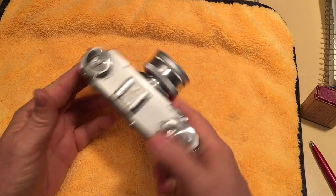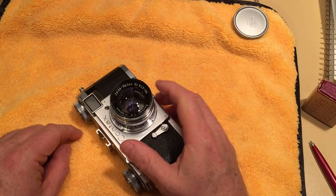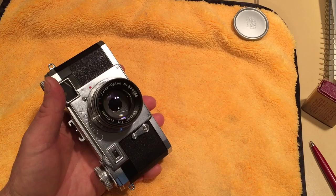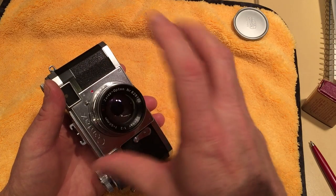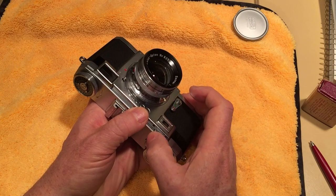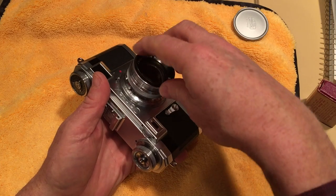The business end of this camera is the front. The only damage I found is a little flat spot on the lens cap for the 50mm. It's got an interesting double mount: normal lenses fit on the inside of this mount, and wide angle and telephoto lenses fit on the outside. The focusing wheel is this little knurled knob here, and behind it there's a sliding lever called the infinity lock lever. Right now the camera is in infinity lock — the lens won't focus or move, but the f-stop ring will.